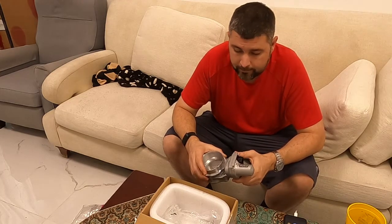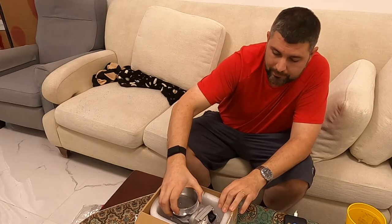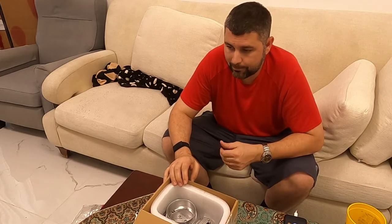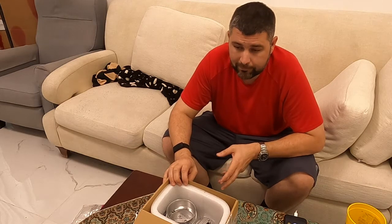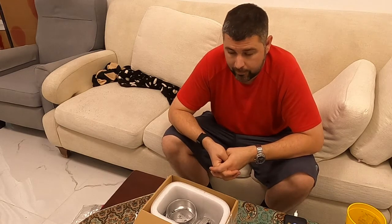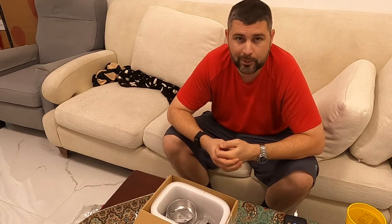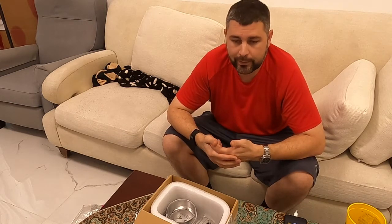I wanted to keep it simple — I didn't want to deal with a 102 or a huge adjustment to the tune. Now the difference between this throttle body and a lot of others: this one is designed around daily driving. It is a 95 millimeter throttle body, up from 90, but it fits in the same opening as a 90. When they say it's 95 millimeter, what they mean is it's 95 millimeters effective, not 95 millimeters physical — it will perform the same as if you had a 95 millimeter hole.